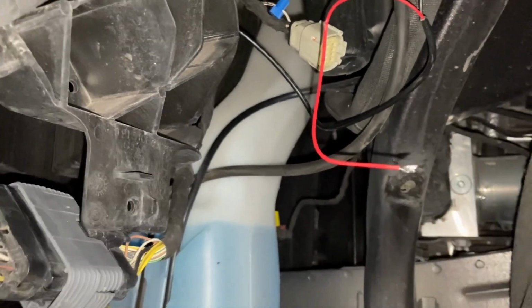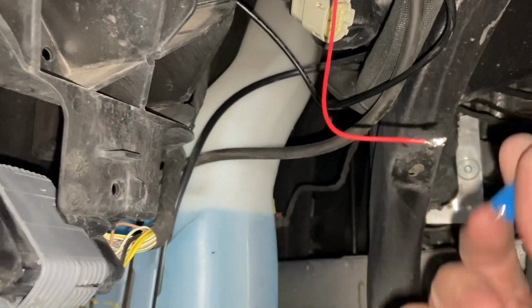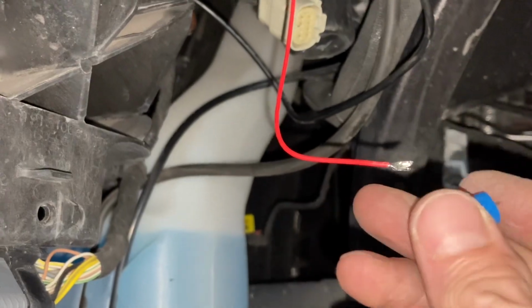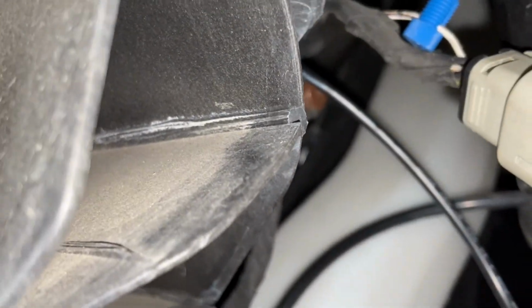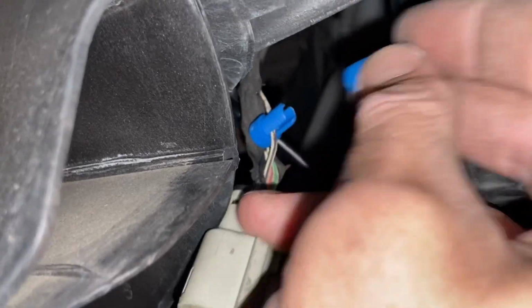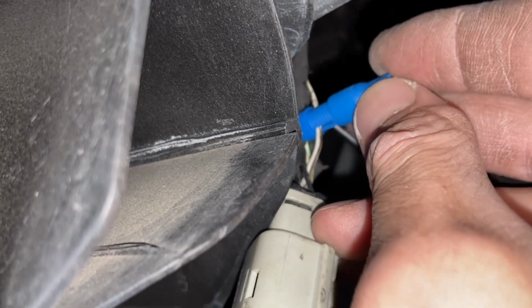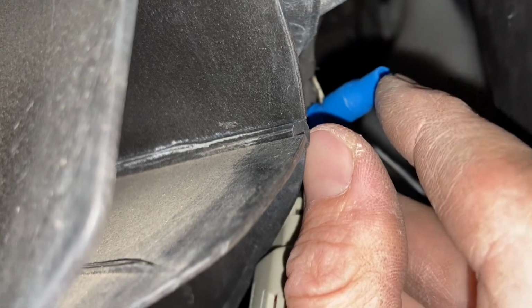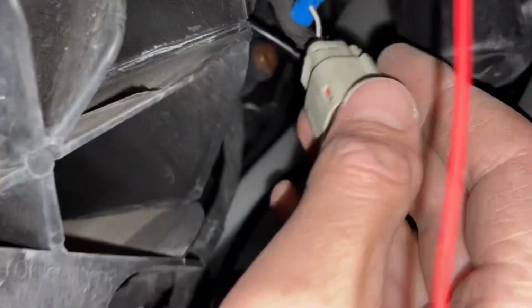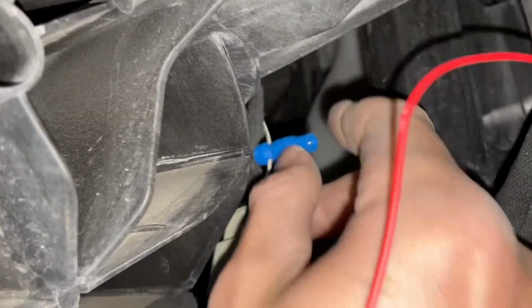So disconnect the back piece, which is this little one here, which holds the wire into the blue body with this kind of needle part. So now, hold this to the side, you can fit this end that has the slot around the wire, and all that's gonna do is allow you to fasten down, tap into the wire, and it's gonna create contact with the copper wire inside of the plastic sheathing. And then once we do this, it's gonna give this piece here on the back power, which will then get fastened to the actual wiring here and juice it up.